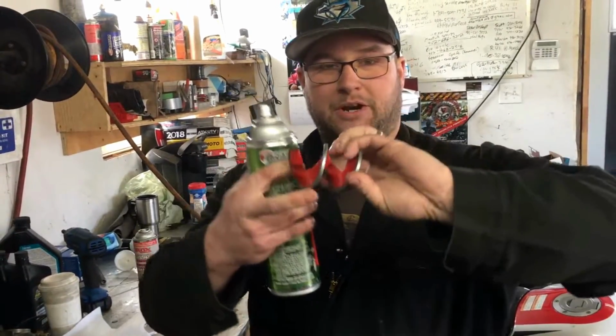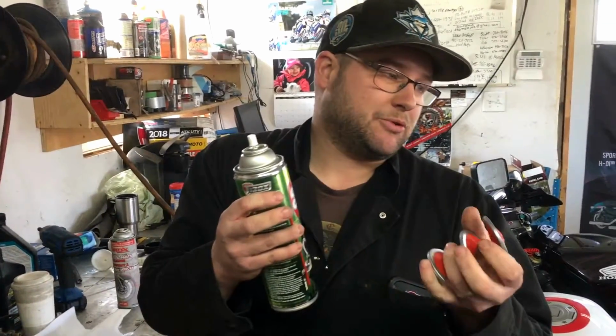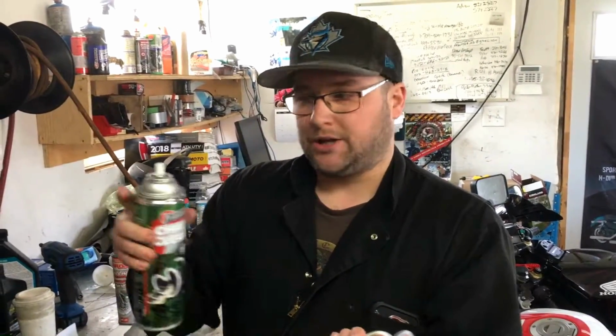You open it up, you spin it onto your chain. This one here you would use more down on the bottom of the chain. You soak it nice with the chain clean, rub it back and forth, and it'll really get all that gunk off. Now I'm going to ask an obvious question.